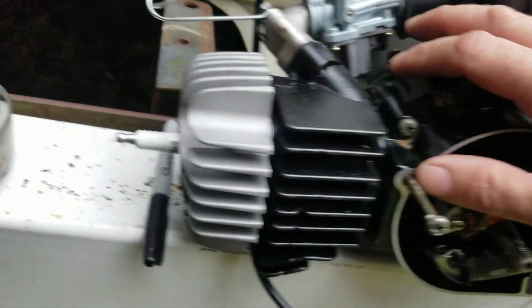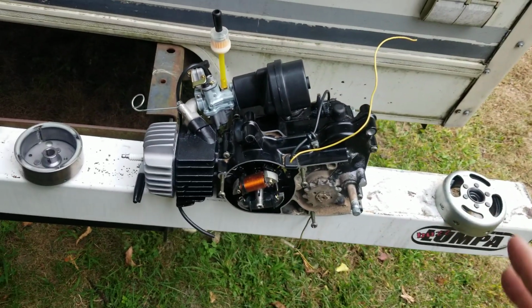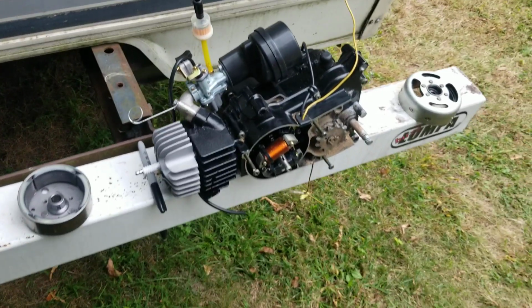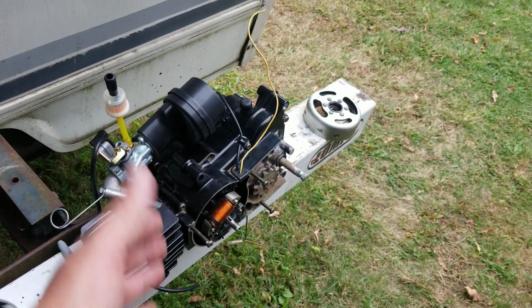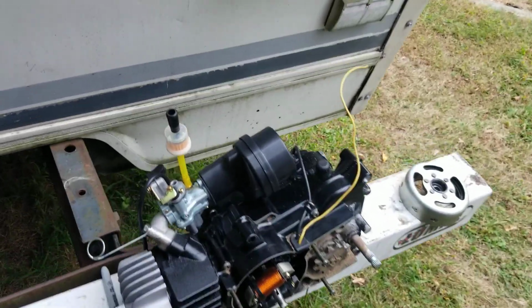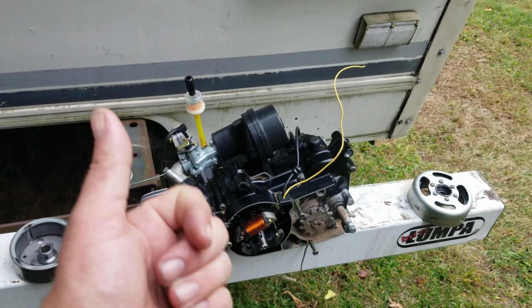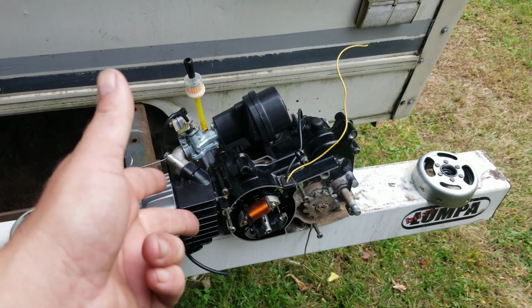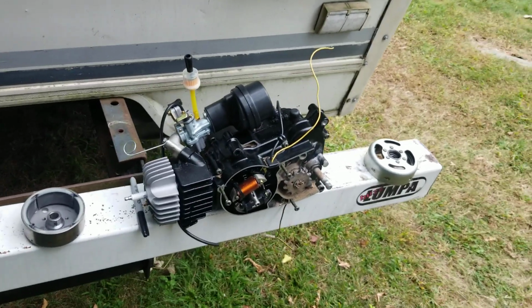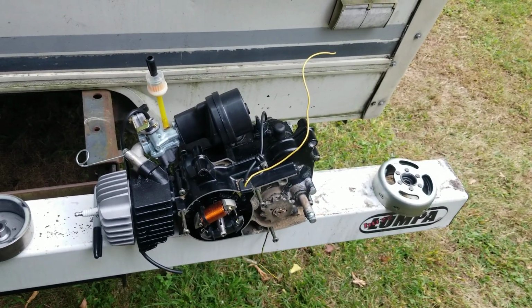This motor right here is used most primarily in the Suzuki. So it's basically a Suzuki engine built for the KV70, the KX50 from Suzuki, and they made these right here for Kawi. I wasn't really sure about that, but they used the same engine. The reason this engine is so cheap to build and everything is so inexpensive is because it's used on the LT50 four-wheeler, the Junior 50, the Kawasaki KDX 50, and many other machines. So the parts for this thing are readily available. However, none of them run that charge coil. So that's where I'm at with that.